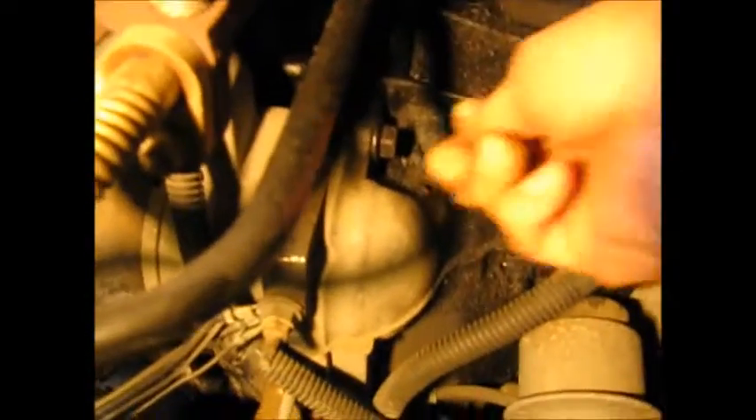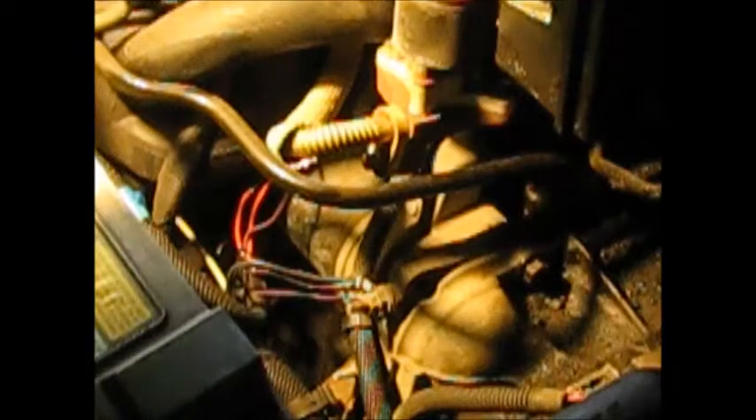The swivel gives us the ability to get away from the side of the starter. Both bolts are broken loose and the starter is now loose. Reaching underneath, I'm able to turn out the lower starter mounting bolt. Now it's just held in by the upper bolt. Holding the starter with one hand, I turn the other one out. The upper bolt is longer — it's going through more material.